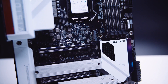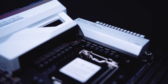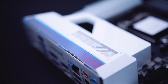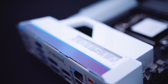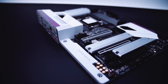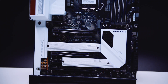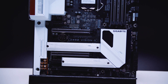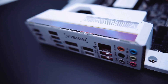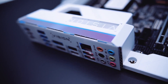Speaking of the aesthetics of the Gigabyte Z490 Vision G, the motherboard sports a classy look with a black, gray, and white combination. It might not please those who expect fancy looks, but it's a cherry on the cake for those who love to keep their build minimal looking. With the Direct 12 Plus One Phase Digital VRM solution that can deliver up to 50 amps, the Gigabyte Z490 Vision G is not meant for extreme overclockers, but a moderate user cannot go wrong choosing this. A beefy heatsink covers the VRMs with a direct-touch heat pipe intended for optimal cooling.